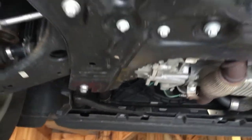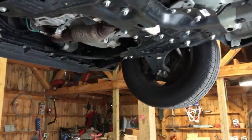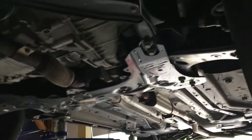Now the front end, as we said before, is a unibody setup, so it's going to have its separate subframe. You can see that's actually connected in quite a few places. So the front end is a traditional McPherson strut setup — you've got a control arm that goes to the front hub and then to the strut setup. It's the same thing on this side. The other thing I should have mentioned: four-wheel disc brakes on this car. Just like most traditional front-wheel drive vehicles, you spin one wheel, the other will actually go in the opposite direction. That's because inside of the transmission is an open differential, and the front two wheels are always engaged in this type of driveline.